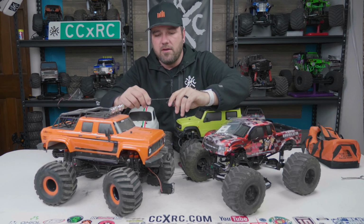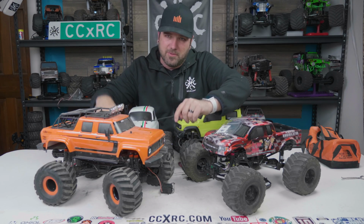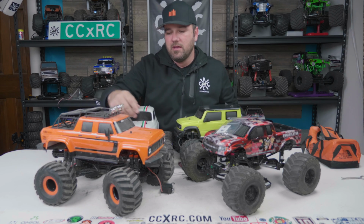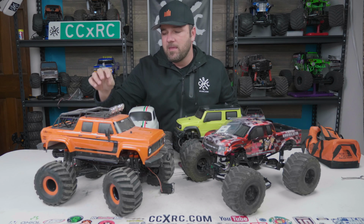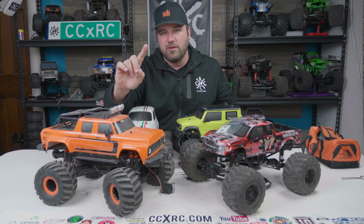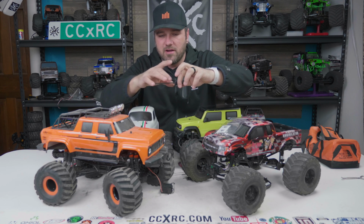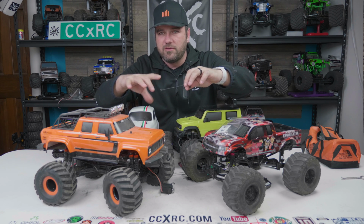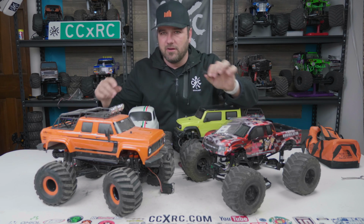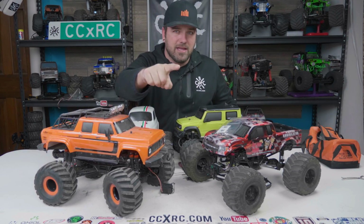So it's quite a run for the stock system to get from the servo, which is mounted up top, back to the transmission, to a bracket that goes back to the front to another bracket, and then moves your steering links on the front of your vehicle. They did that for a reason, because they wanted to offer four-wheel steer with just one servo. That little middle part of the truck, when it moves, would allow you to attach another one of these setups to the rear end and have four steer. But we just want good steering for great controllability, and so that's what we're going to show you guys how to do right now.